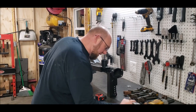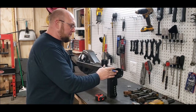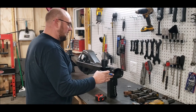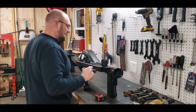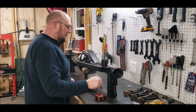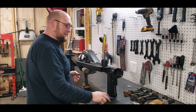So the stock width is 56 and 3/8 inches. I'm using the same brakes and the same exact axle offset because they're both Strange 40 spline. So I can take the backing plates off this rear, put them on the new one, measure, and get a good indication of what we need. Theoretically this should be 50 and 3/8, but I want to confirm — for reasons.